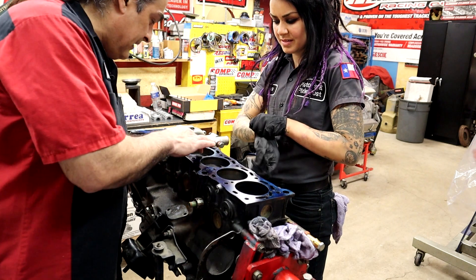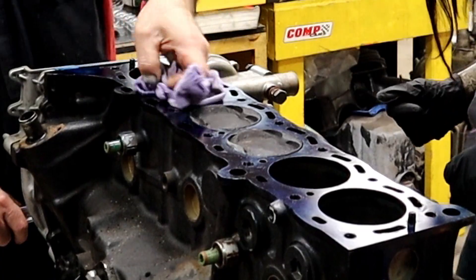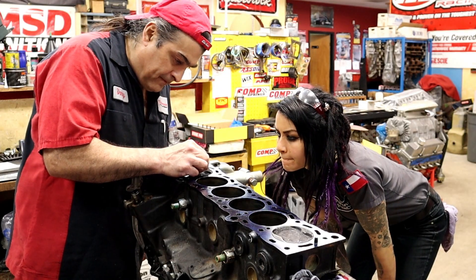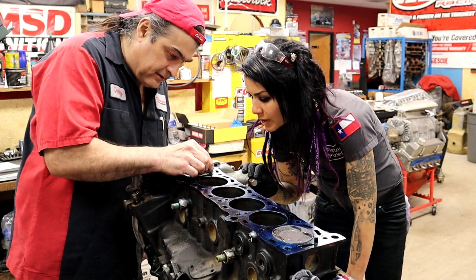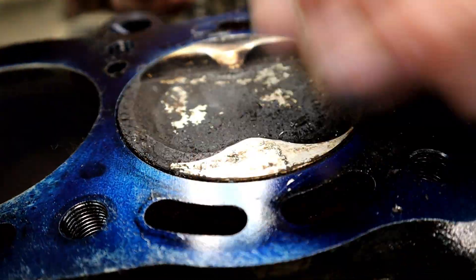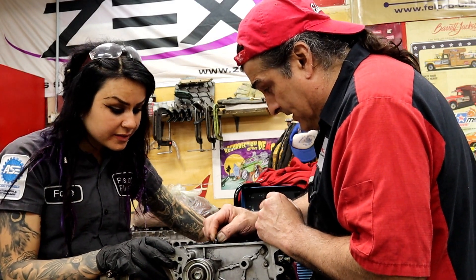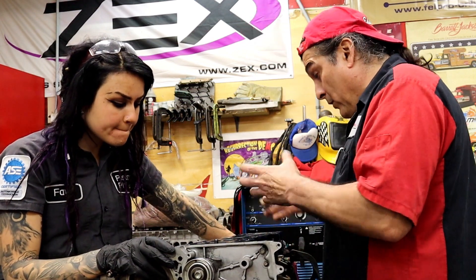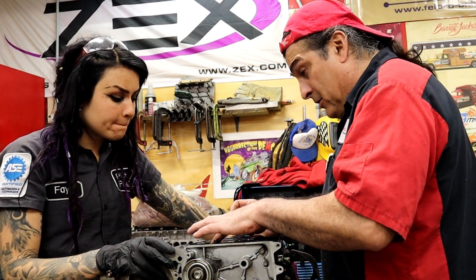It's a good quality forged piston. See how high it protrudes up — you're way up there, which is what you want. I'm wondering why — I know why we have so much carbon — but see how over here it's not as much as over here. You can see quite a bit of oil has been burning. You have quite a bit of carbon — more than your average oil in the cylinder. All of this is from oil in there and then it burns. You've got a turbo, it got a lot of heat and you cook all that oil.